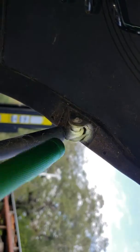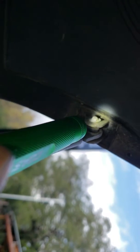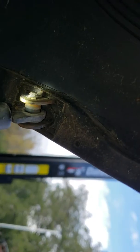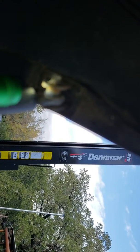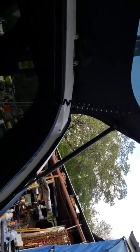If I can get some light on the subject here — it's got a pin right there. Sorry about the quality, it's getting late so my phone won't focus. It's got a pin. If you've ever worked on lawnmowers, a lot of the wheels have those pins that have a little clip on the end. All you gotta do is put a screwdriver behind it, pry it out, and then push the pin off.